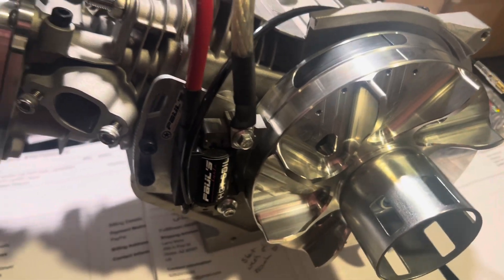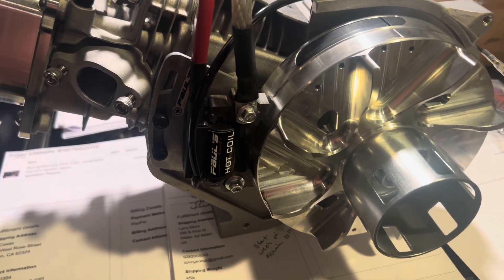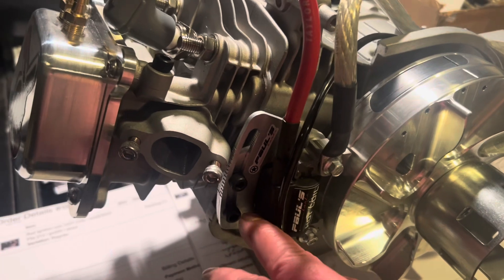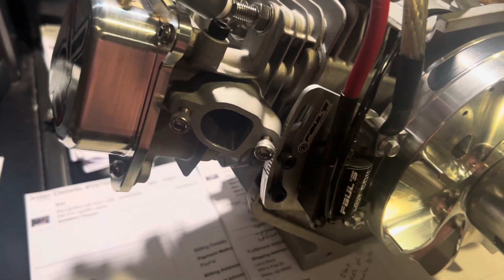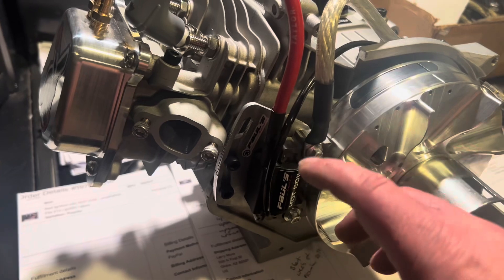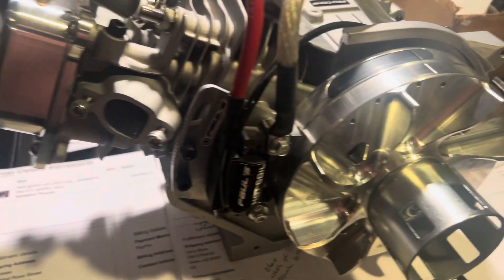So that's basically the ignition coil bracket in a nutshell. For our coils, I always want 60 thousandths coil gap. Tighten everything down — these go to five foot pounds. Once you lock this down, you put however much timing in it and tighten them back down.